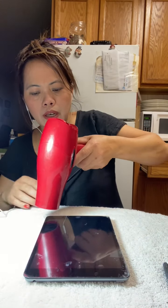All I have to do, guys, is heat around the digitizer. I'm just going to show you quickly, but I already did. Heat this area around, and keep going until you think the paste is soft. I keep doing it until it opens easily.